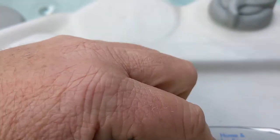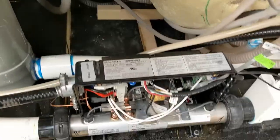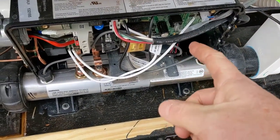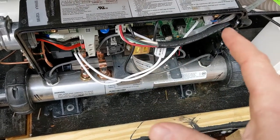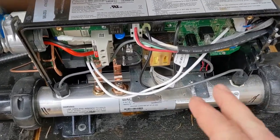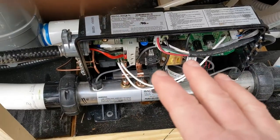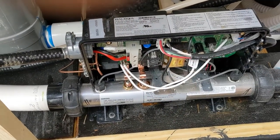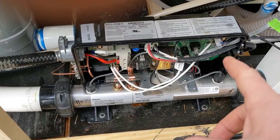The biggest thing is every time you push this button there's no clicking — nothing — so it's a bad sign. As soon as we unplugged the top side and it didn't turn on and we hear no clicking, it's a board issue. You've got to replace the board, and all the information is right on that board. This applies to any hot tub.